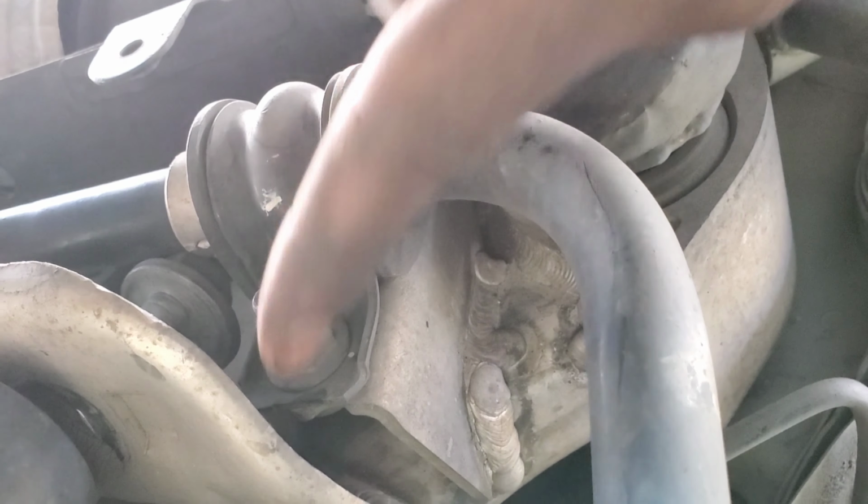I got the actual freaking traction arm in. Was not easy. What I found easiest was to actually get the bushing side in first and then slip the arm side in with force up through the camber arm and then to where the traction arm is supposed to be. Real tough. Sorry for not really showing you guys what's going on. It's hard for me to position the camera and to do the work at the same time, boss.